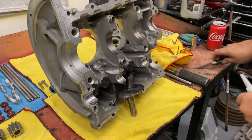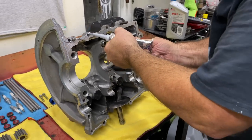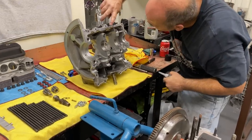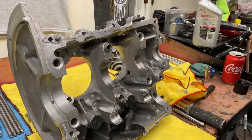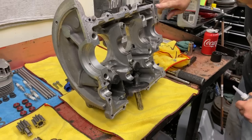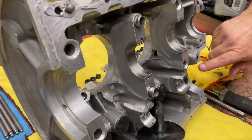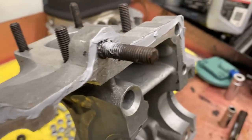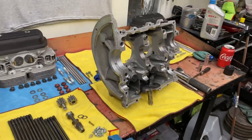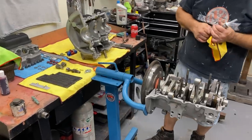You've got the Swiss cheese clearancing on these Volkswagen motors to get the bigger cranks in them. I had to align the oil holes on the aluminum cases — it's pretty critical that you check the alignment of the bearing-to-oil hole. These cases come clearanced for an 86 stroke and bored for whatever you want. They're solid behind number three over here, so it's a pretty nice case.